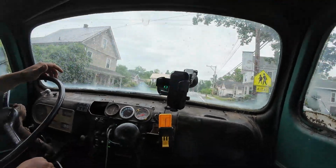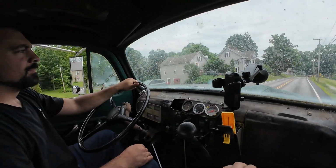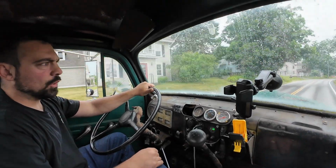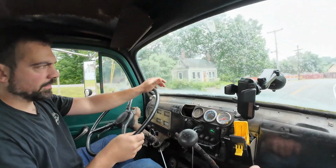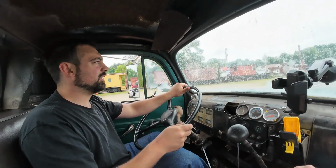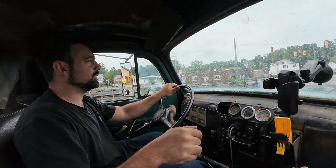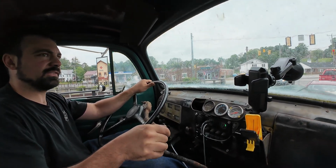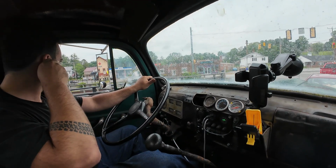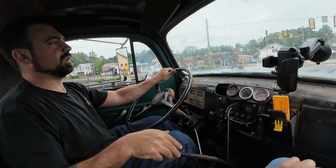How are the brakes on it? They're okay. They're safe. They're set up right and they're all new. The geometry of the pedal is a little weird, so it uses a lot of pedal travel. It feels like there's air in them, but it is not. And they are just 1-ton truck brakes going through 22.5 tires. So, you know, they're not gonna stop like a Corvette, but they'll do the job. You can panic stop. You can't really lock them up, but it really needs Jakes for going down consistent hills with a load.